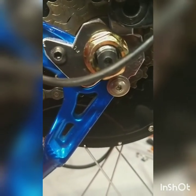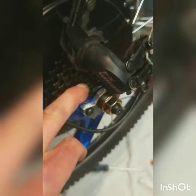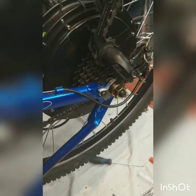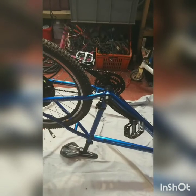We've made these little brackets that hold the axle in, then bolted through underneath both sides and tightened it all up. I've now got clearance on the caliper — not much but it's enough. We've got the middle five gears working on the back, and the second torque bracket wraps over the top of the axle and bolts through the frame. The only problem is it won't quite go in on the lowest cog because it's too close to the frame — we're already stretching it quite a bit. You don't tend to use the low gears much anyway; you can't keep up with the motors.